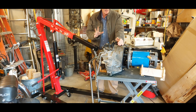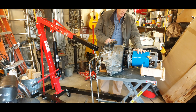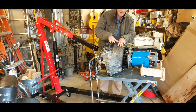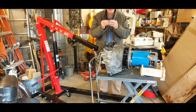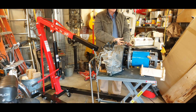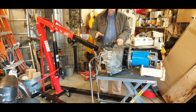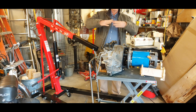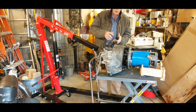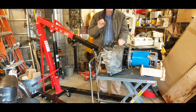Let me explain my crazy scheme. The way I'm going to balance this driveline is this motor has got to be slid around in relation to the transaxle such that the driveshaft exactly lines up. If I try to do it while it's on its side I'm going to be fighting gravity. I'd have to loosen all these mounting bolts and it's going to be cocking, and I'll have to jack things up, lower things down — I don't relish that fight. I'm bound to lose it.